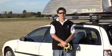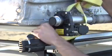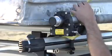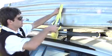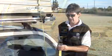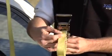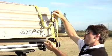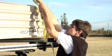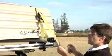Now we need to secure the boat to the boatloader using the ratchet straps provided. Loop the first strap around the winch and over the boatloader crossbar, then throw the remaining strap over the boat. Repeat this process for the front strap. Connect the strap to the ratchet, feeding the loose end through the axle and back out the top. Now loop the strap with the ratchet end over the top sliding bar of the boatloader, adjust out the excess, and tighten.